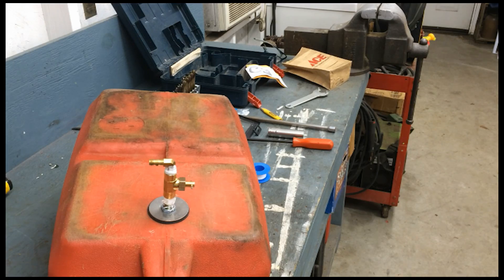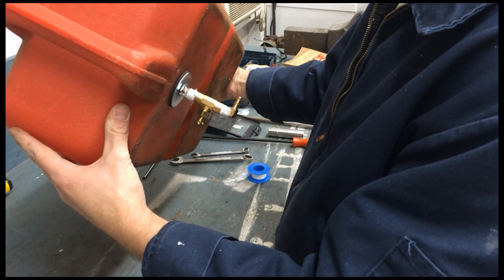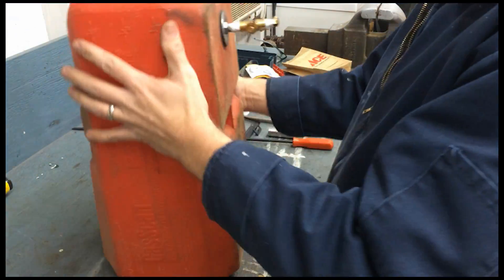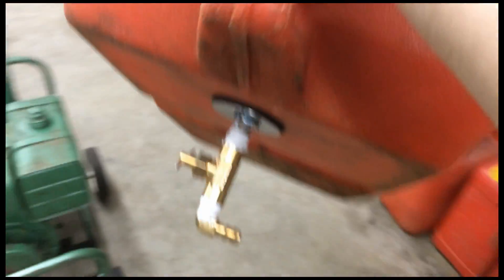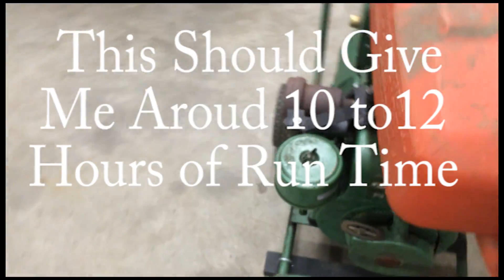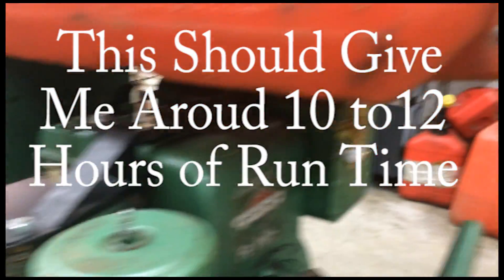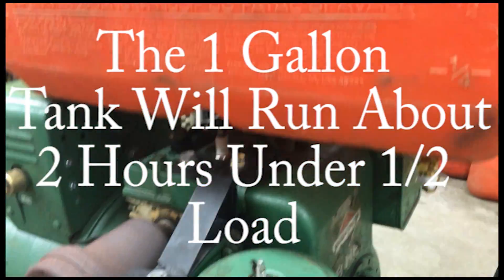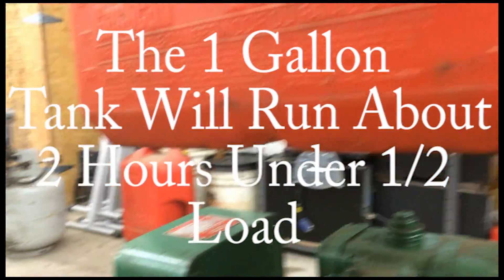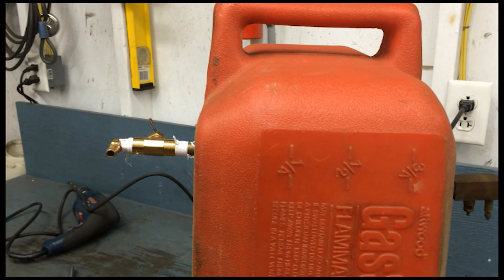And there, my friends, is a gravity feed fitting put on a marine tank. Hopefully I'm going to put some fuel in it and let it set to see if I got any leaks, but hopefully I don't. What I'm planning on doing is not use the factory tank that's on it because it's only a one gallon — this one holds six. I'm going to mount it up on a little tray above the generator to feed the generator. Thanks for watching guys and we'll see you on the next video.